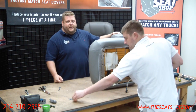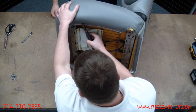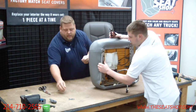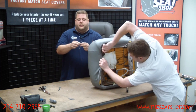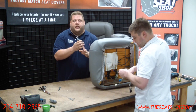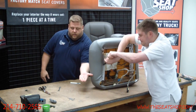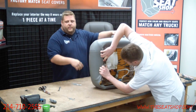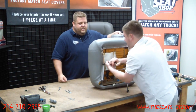This is where it really helps to have the hog ring pliers. You can see there's going to be a lot of them around the bottom rim. Like I said, with needle nose you can do them, but man, they'll be shooting all across the garage on you. The little pair of hog ring pliers that we sell for $6. The only difference with what a hog ring plier really does is there's a groove cut on the inside flap of each of the prongs here, so that the hog ring sits in this little channel. So it's sitting up like that. And they're set at a slightly different angle from each other. So when you crimp it down, it bends it into this triangle loop here that holds it on. That's all it does. It's a real simple tool, but man, if you don't have one and you're doing one of these, you're going to call me and not be too happy afterwards that you didn't get a pair of those hog ring pliers when you started. There we go.